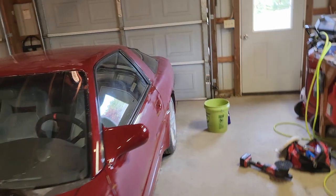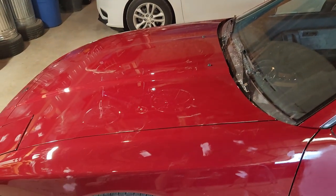Last night we left off with all that stuff done. I might try to get to buffing tonight. I'm going to block the fenders, the hood, and the hood extension. I'm not going to worry too much about the bumpers since plastic buffs a little different than metal. I gotta make the hood extension match the hood. Then I'm going to wet sand everything on the DA. The whole painting process — I said I'd be done today, two days later I finally get done with it. That's probably how this is going to go too.